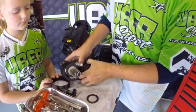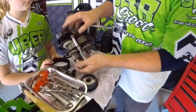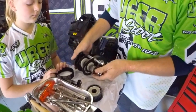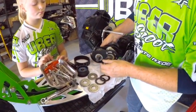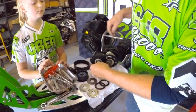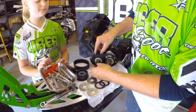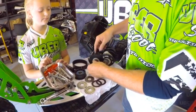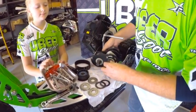Now I remove the second gear system, leaving the first gear system behind. We check that the one-way bearing feels good on the first gear — make sure it rotates in one direction and not the other. Many people install the one-way bearing the wrong way around. If you install it wrong, the bike only goes in reverse, not forward. So always make sure your direction is correct when assembling.